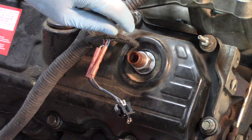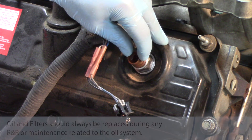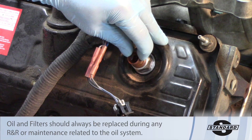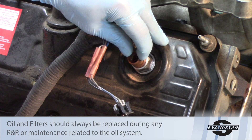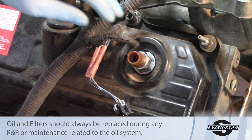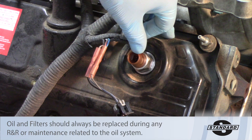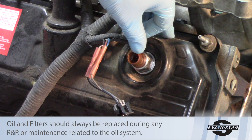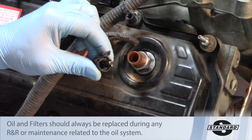These ICPs are pretty sensitive, so we want to make sure we always do an oil change any time we're doing anything related to oil pressure, fuel pressure, or any type of pressure-related components on these 6.0 Power Strokes. It's always good to go ahead and get an oil change done, fuel filters, oil filters — those kinds of things — to make sure this sensor can do its job as thoroughly and effectively as possible. Hopefully now you have a better understanding of the importance of replacing both the ICP and the pigtail at the same time.